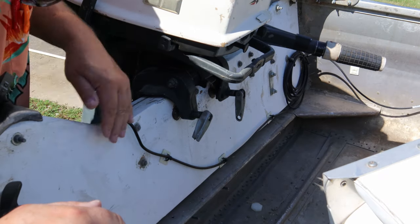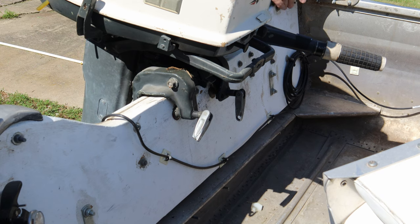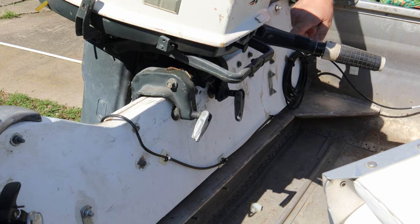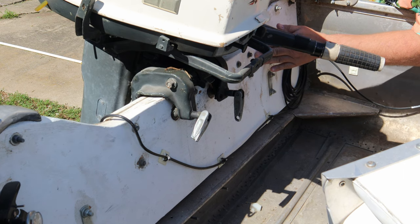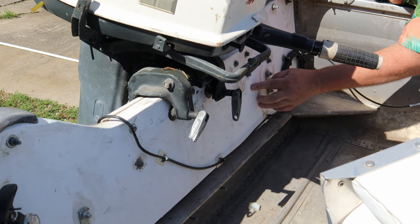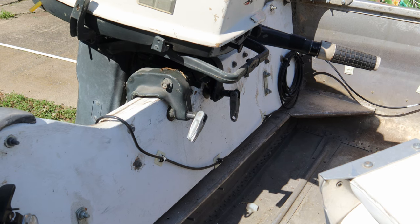Now the transom, this was a 2x that I put in here that goes all the way across a big, big, no, what did I do? No, I used plywood. I used marine grade plywood, that's right. I almost forgot, double thick. So it's 1.5 inches, because I think I used, it looks like 3/4. So this is 1.5 inches marine grade plywood that I put here and then gel coated it, resin and gel coat. And it's still in fantastic shape other than, as you can see, if I just rub the old, I got silicone around all these bolts to seal up everything when I put it on. And it collects a little dust and dirt, but as you can see right there, that cleans up. Makes it look like brand new.